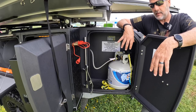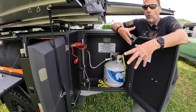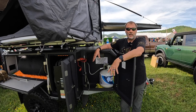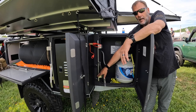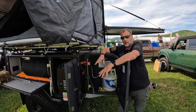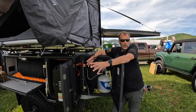One of the things I really like is interior storage of the propane — I don't have one unsightly tank sitting out here, and it's also drastically safer. When I pull up, I hook up to a tank, turn it on, and shut the door — I don't have to touch it again until I'm ready to move camp. There's a regulator inside, and it comes out to two quick-connect gas connections. I can run multiple gas connections at the same time — one over to a grill, one for the shower, a propane heater, whatever I want.